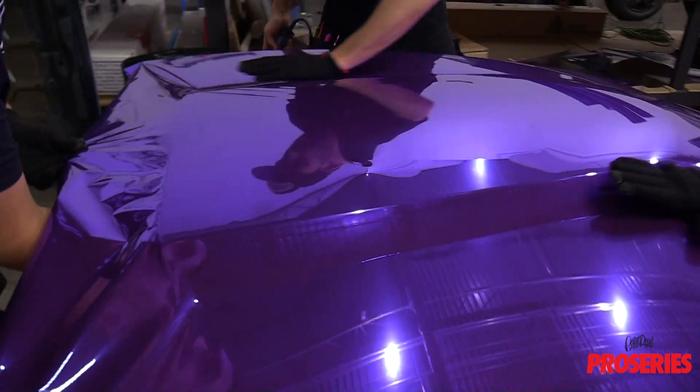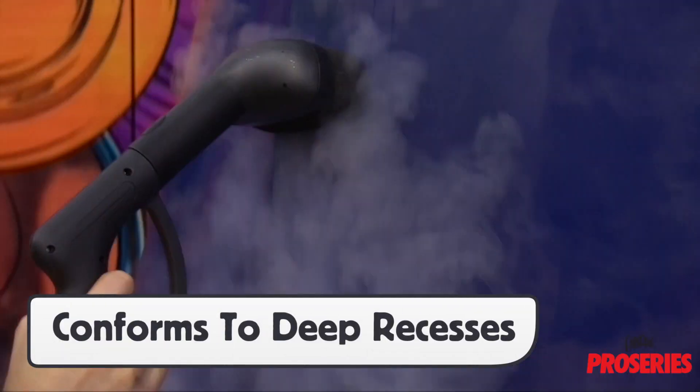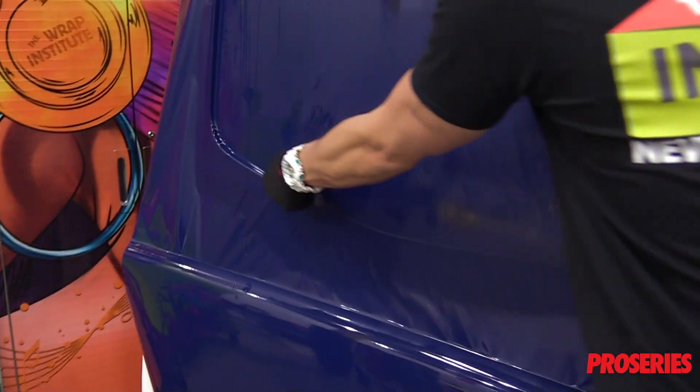This creates high workflow as well as avoids adhesive lines. For deep recessed areas commonly found on vans, the seamless tips help ensure that the wrap film adheres to the deepest part as opposed to bridging the gap, which can lead to bubbles and overstretching. Maintaining moisture in the Pro Glove is critical for deep recessed areas.